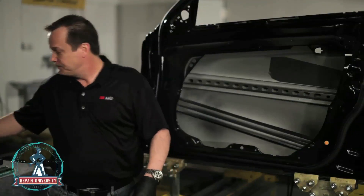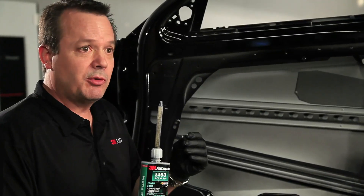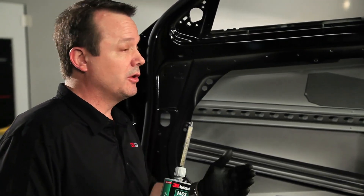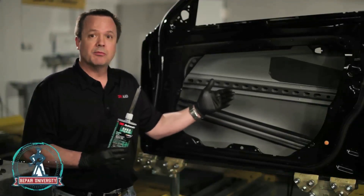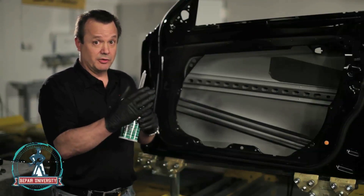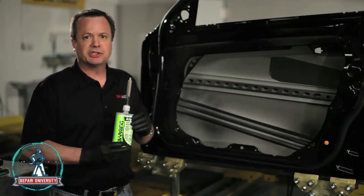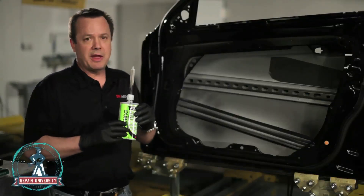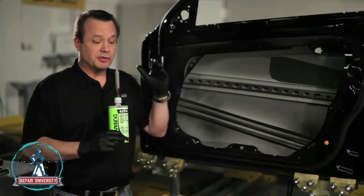There are correct products designed for this purpose — one would be a flexible foam. As the name says, it's flexible; it'll flex in and out as the door skin moves. This metal door skin will expand and contract with heating and cooling cycles just like any other panel. If we apply something solid to that panel that does not allow it to move, we're going to see ripples down the door. There's also a material called an NVH — noise vibration harshness — material. This is also soft enough to allow the door to expand and contract, and it's 100% solids so you won't get any shrinking that will draw that panel in.